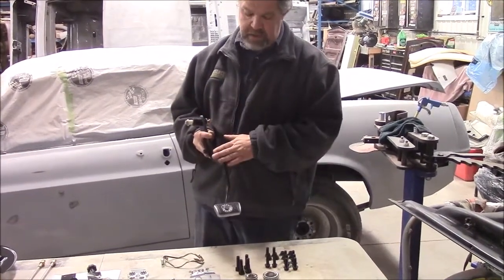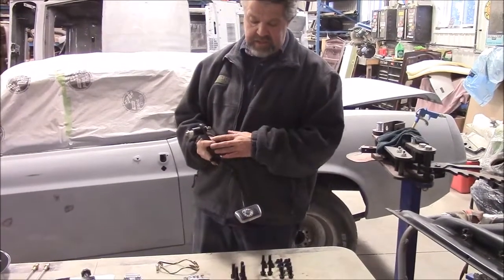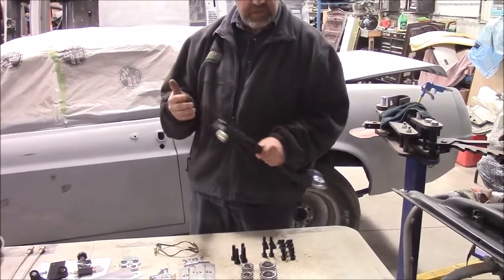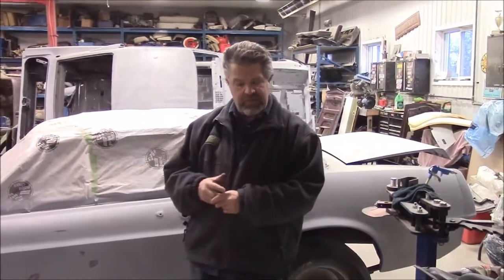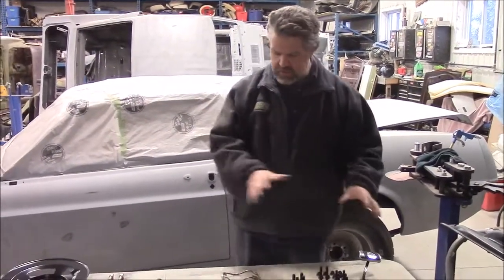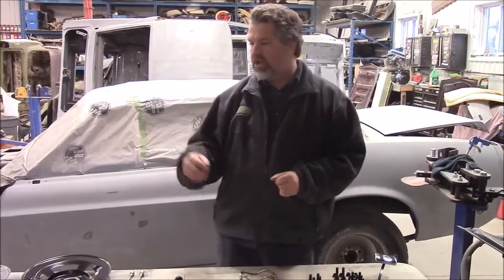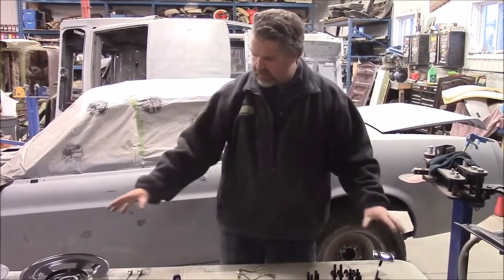This pedal, being part of the disc brake conversion, is part of this kit and it's an important piece. We have to make sure that with all the bushings and levers, everything fits the original piece we purchased from a vehicle that was originally a manual Mustang. So these are all the nice components to convert the front drum brakes, non-power, to a power disc brake conversion. We have all of our components here.